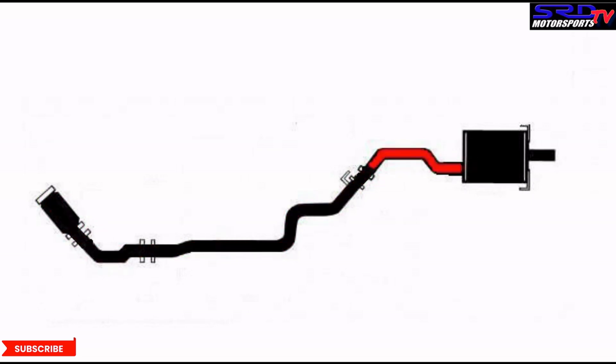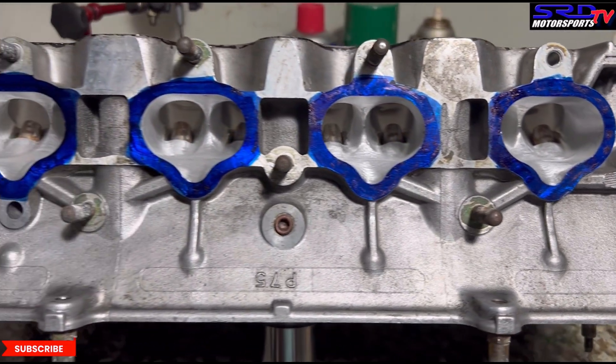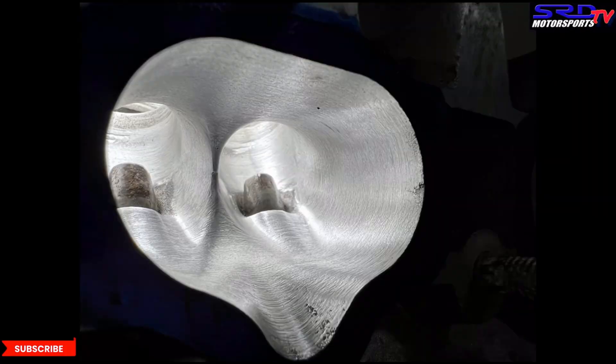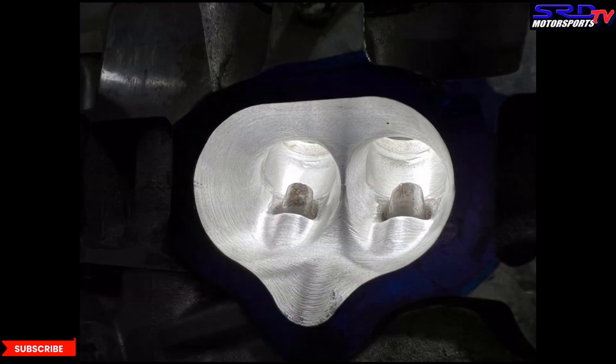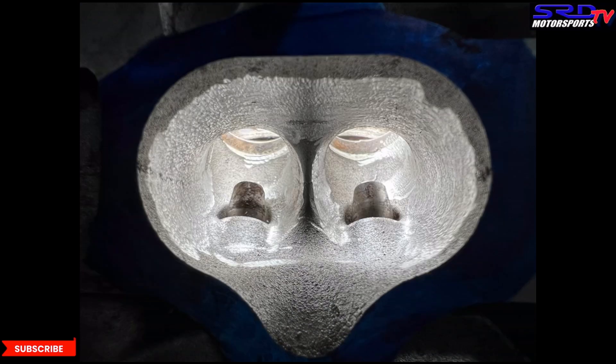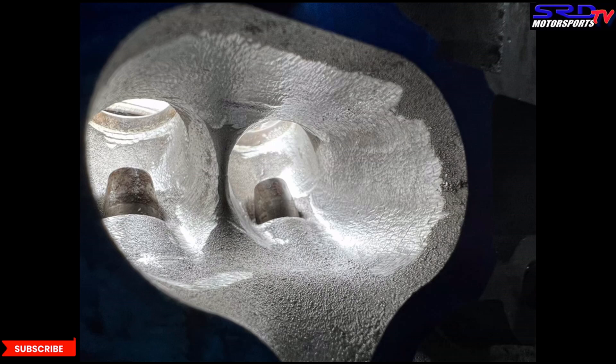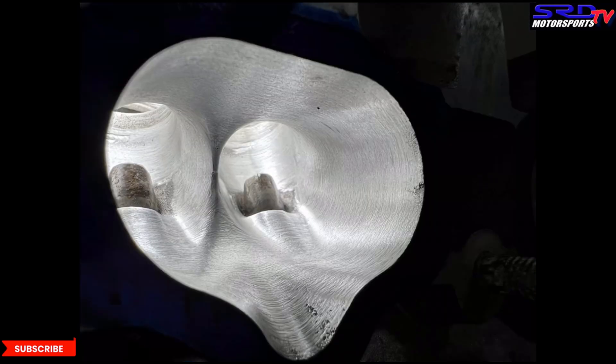This is why even on motorcycles, a tuned pipe is important — the length is critical. Those are two strokes, but when we're talking about harmonics, it does not matter if it's two stroke, four stroke, or whatever. Sound is sound when it comes to harmonics and the length. Now let's go back to the intake. It's all finished up and shaped well. We can go with the before and after — stock ports, then carbide shaped, then 80 grit. You can see the difference. On a different angle, you can see how the shape is achieved. Efficiency is our target.